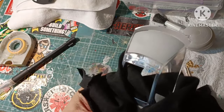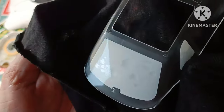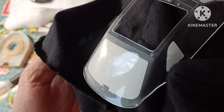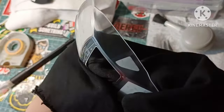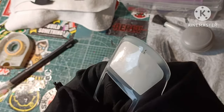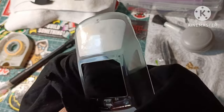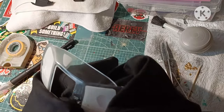Here I've got the masks installed on the inside of the windows. That black cloth is actually just a vest — two pounds, 100% cotton — and I like using it for buffing off and also for rubbing the mask sticker templates in on the windows, making sure I've got all the edges burnished as much as possible so hopefully when it comes to painting there'll be no paint bleed.